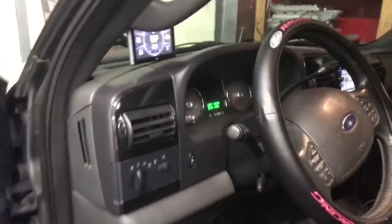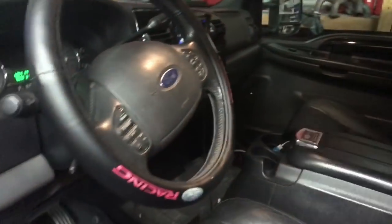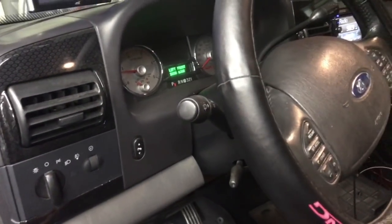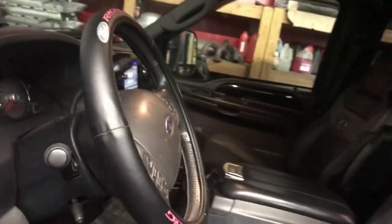I'm gonna pull it outside and see what happens. What a freaking drag. Just hoping to run some diag — get it to where it's broken and start chasing the wire backwards through the fuel inertia switch, up to the battery box, and everywhere. What sucks is we can't really diagnose it when it's running, because when it's running, it's working.